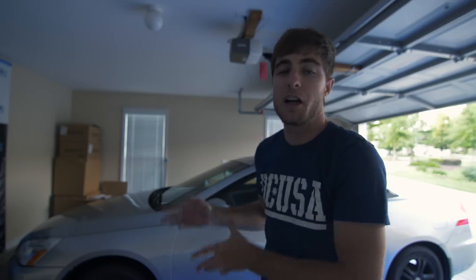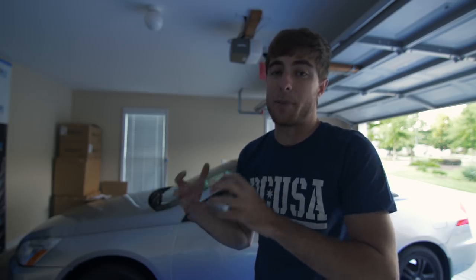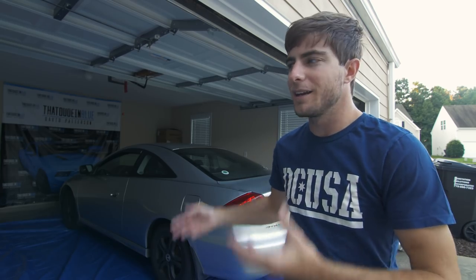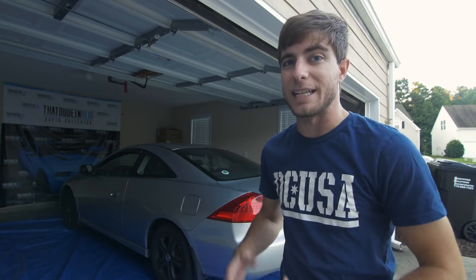So the most important thing you wanna do before prepping the car for Plastidip, if you're doing the entire car, is to clean it. You wanna wipe it down, have no moisture in the car, or the rubber won't bond perfectly. It's gonna be kind of weird. So you're gonna wanna wipe it down as good as you can and get as much dirt off the car as possible. Normally you do wanna wash the entire car and get it really dry, but since we don't have that much time, we're basically working until she's off work. I just wiped it down as good as I could.